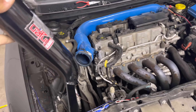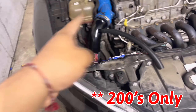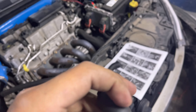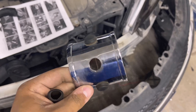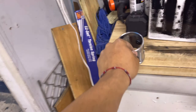Here's our tube and vacuum hose part. We're going to drop it in, rack it through, and set this thing in place. Now for the 200 portion - this is not for the Dart guys. I've got my tubing here connected, and it's going to wrap around and connect right into here. What I did was I took the stock tube of the car, cut it, made a little plug using one of the vacuum hose adapter spacers - I took out one of the plugs and popped it in there, making sure it's super tight with no leaks. Now I'm going to cap off that tube on our car and connect it in - and now you're good, vacuum is up.